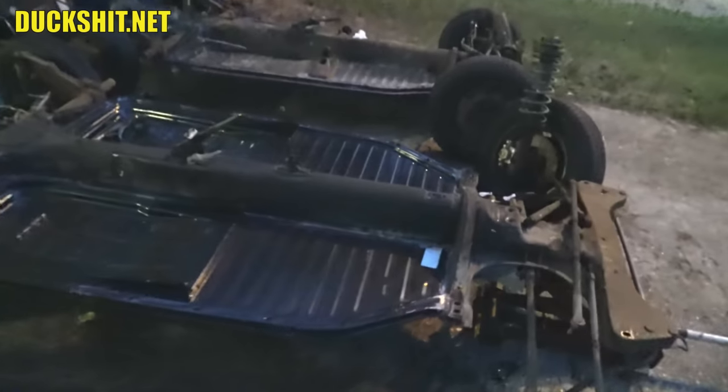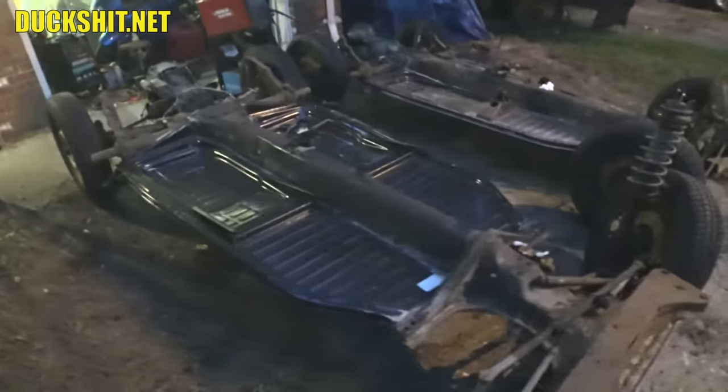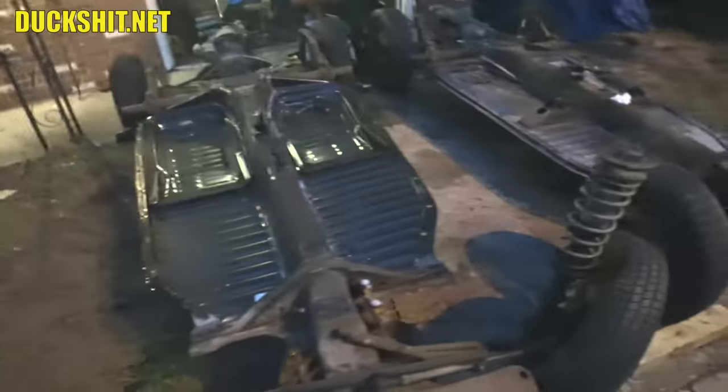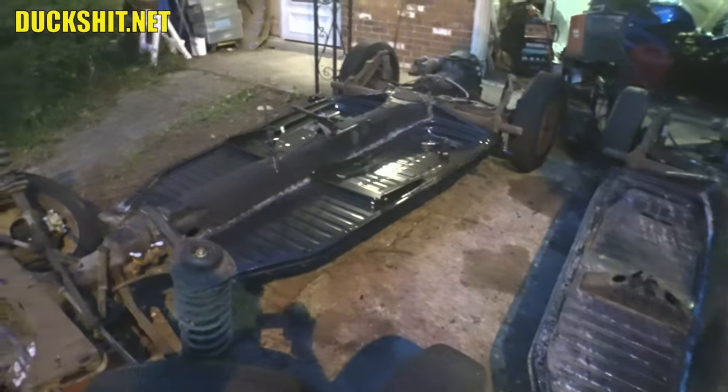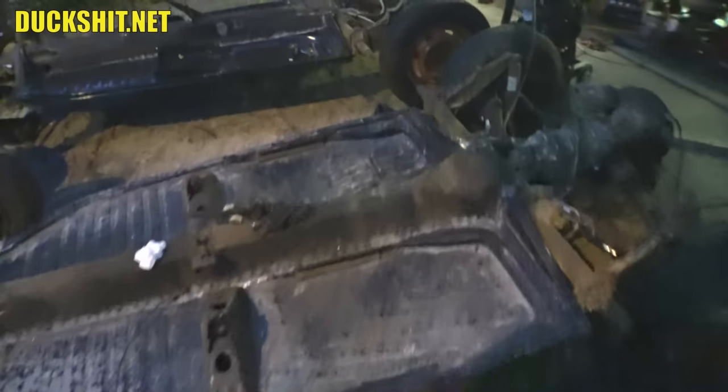I can't find my phosphoric acid tonight — I've got one bottle left. I bought a ton of it on clearance about 10 years ago and I'm finally starting to run out. William's floor pan is in, Robert's floor pan is in. Welds are spaced between an inch and two inches apart. I don't do anything tighter than that because you want a little flex in the floor pan for thermal expansion and contraction; otherwise it'll fatigue along the edges and pop the welds. That's the way Volkswagen did it, so that's how I'm going to do it.